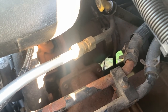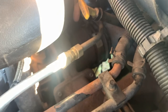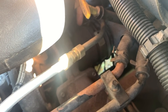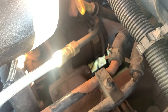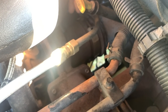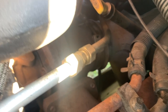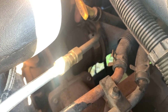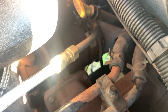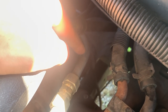It looks very close to stock, but I'll show you the main differences here. So when you look at the back of the exhaust housing here, what you'll notice is the exhaust exit is way different. There's not a little turbo flange that bolts on the back, and then you bolt your exhaust to that little flange that turns down. It's actually, he's got a 4-inch exhaust mounted directly to the back that's not belled down at all. It's just straight 4-inch to the back. And then once it gets down to about the transmission, it goes from a 4 to a 5-inch.